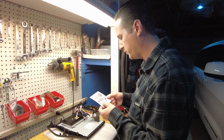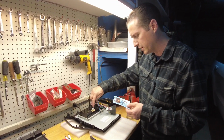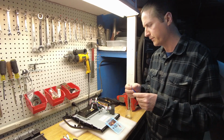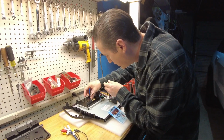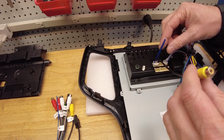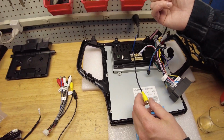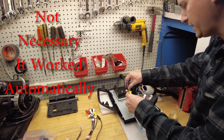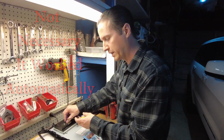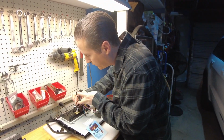All right, number 2, 8-pin for CAN box. Oh, that's what I already plugged in. Radio antenna, 10-pin for camera. So this must be for the reverse camera. That plugs into the top left corner of the wiring harness. And I believe that's going to be something that I'm going to have to figure out, the triggers to tap into the reverse circuitry. So when we put it in reverse, the input on the tablet changes to the reverse camera. 4-pin USB and 6-pin USB, they go into the center of the harness.